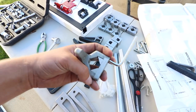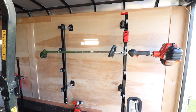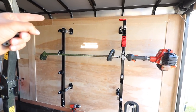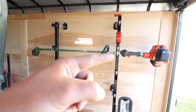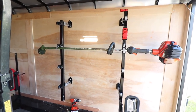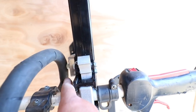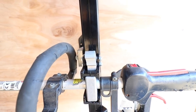Here are your mounting blocks — pretty simple, pretty straightforward. We're going to use the Allen wrench, loosen them up, put them on my edger and also on my trimmer. We've got the Echo 2620 mounted. Now this rack is a smidge short — I measured correctly, I think it's just the way it's designed with the square bracket versus the bracket that feeds through. I had to move the rack from this mount all the way to the next beam over. The style I have hangs over the handle and I lost about 10 or 12 inches, so I had to bring the whole rack one notch over. It took about 10 minutes to undo and redo — not that big of a deal. With the Red Max 260TS, you have the shoulder strap clip and the handle which is very close to this mounting bracket, so it was pretty much just barely fit — you have to shimmy it a little bit to line it up correctly.